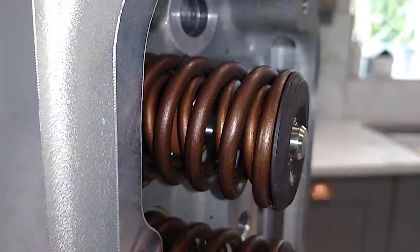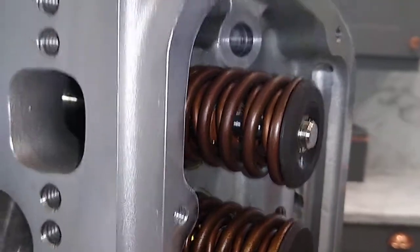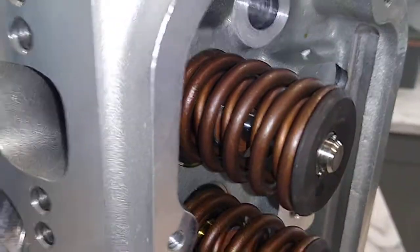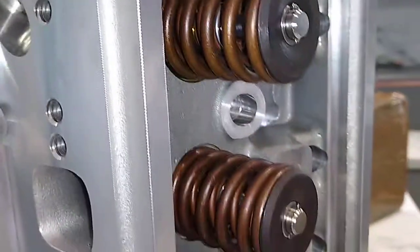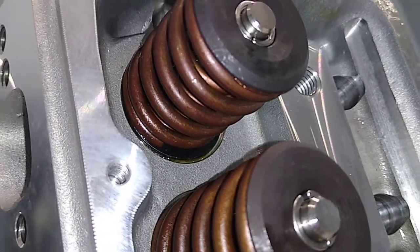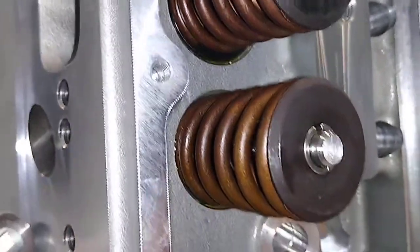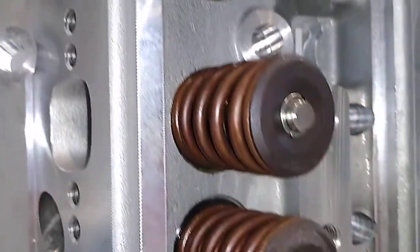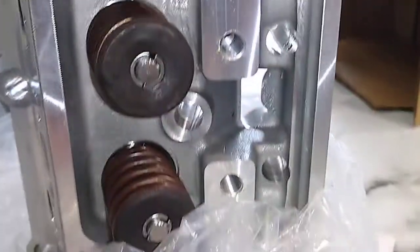Double valve springs. Now I've seen on a few forums and YouTube videos that the actual spring hardware is pretty good, and so are the retainers. And it looks like we've got spring seats installed, whereas I've seen some people that haven't had them on the eBay jobbies, and the springs are sitting straight on the aluminium. And also, you know that springs can rotate and dig into the aluminium as they're working. I have to admit, looking pretty good. Well impressed.